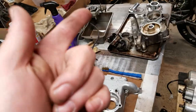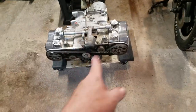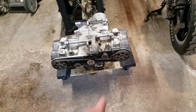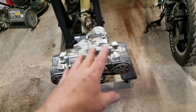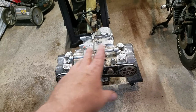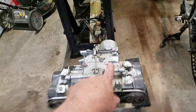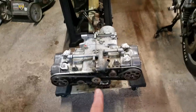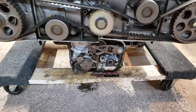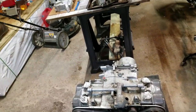It's an '80s model bike so it makes sense it wouldn't have points. Those cleaned up nice. I'm waiting on parts — mostly gaskets and then the water pump. I'll need to get the guys back here to help get it in once I put it all together. Then I'll clean the engine up because the only ports I want open when I hit it with degreaser are the intake and exhaust — I can cover those with duct tape. Any vents like this one I'll make sure are covered, since that's where the water pump and everything resides.